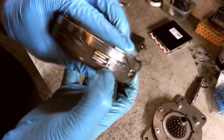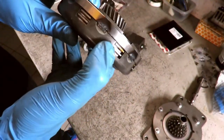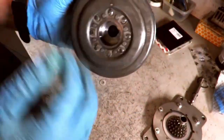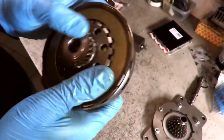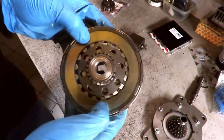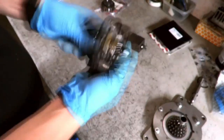Furthermore, the fillets on the discs, I don't know if you can see on camera, are induction hardened, so that the bell won't erode. This is an item that costs around 120 euros, but it's worth all the money it costs. It solves many problems that the clutches of large frame Vespas have, especially 6 and 5 springs.